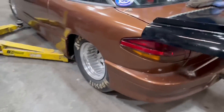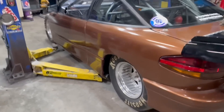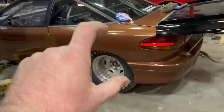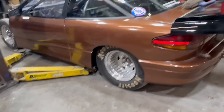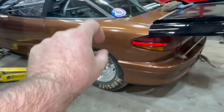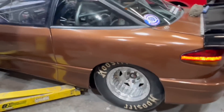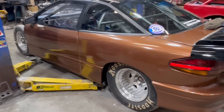It's a little hard to see exactly how much everything is, so I'm going to throw this thing up on the lift. This was our backside setting — basically on the backside we try to treat this thing like a radial car, we try to make it separate. We put a lot of weight in the back and a lot of spring to support the weight, so we can make this thing kind of behave like a radial car. Some of the fastest no prep cars on the backside, when they hit the transbrake button, you'll actually see it separate — meaning the gap between the wheel and the wheel well increases.